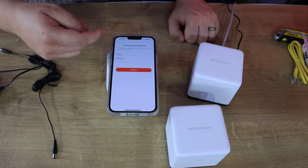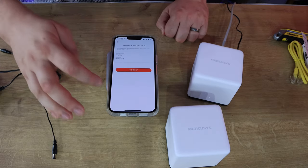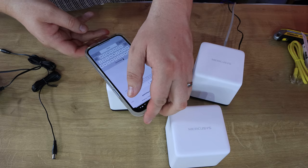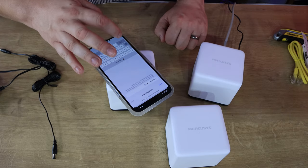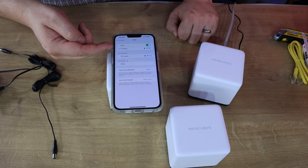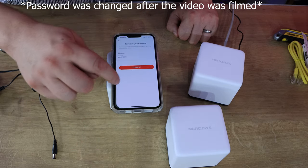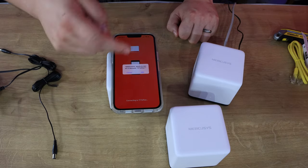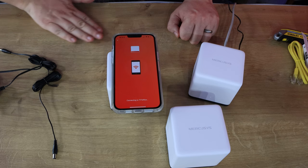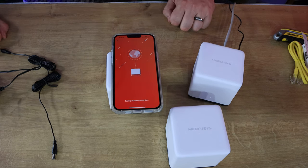It says setup is complete and to connect to your Halo Wi-Fi. Because we've changed the network name and password, we need to reconnect in settings. I can see TFTOffice in the Wi-Fi list - I click on it, type in the password ABCDE12345, press join, and it connects with a tick and no 'no internet' warning. Going back to the app it confirms it's worked. Pressing connect, it asks 'do you want to join?' - press join. At any of these points pressing cancel will stop you, so you need to press join, accept, and yes whenever asked. One node is now up and working.